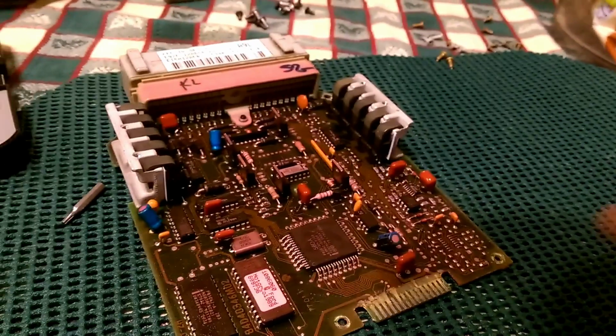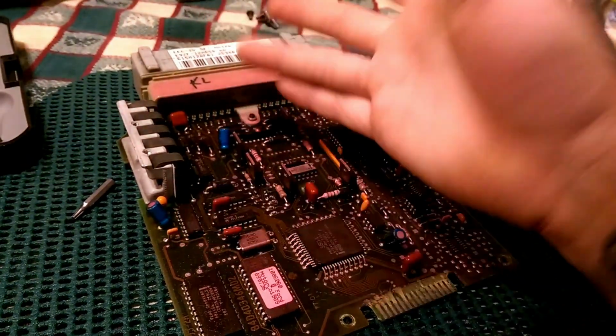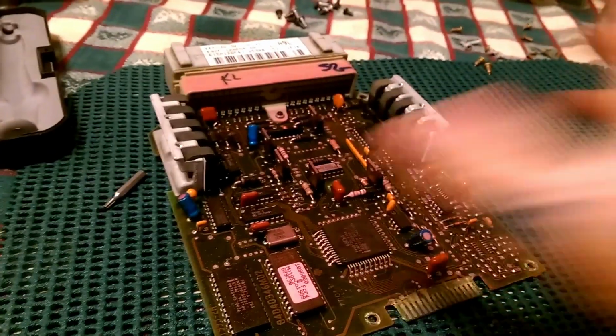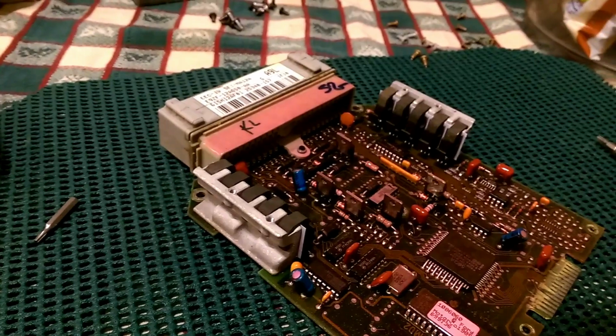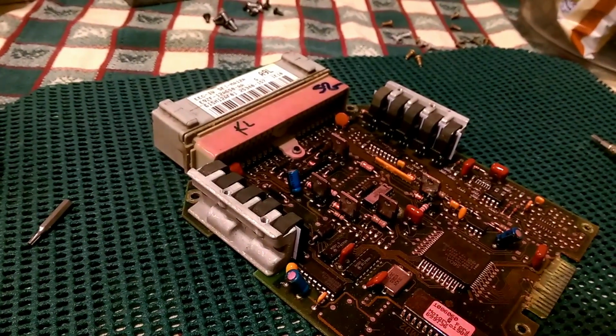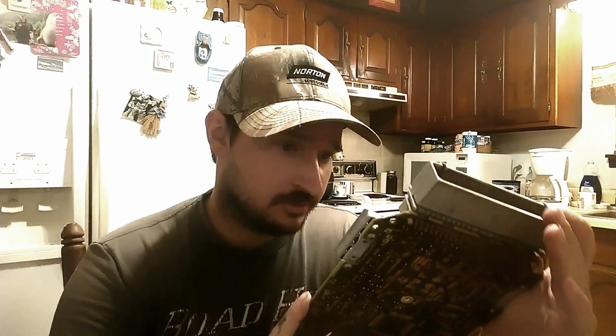Now this is due to age, moisture, age, and they leaking. It's electronics, they don't last forever. And a lot of Mustangs this happens to, even the 94s and so on. Okay guys, that pretty well shows you how to inspect your board. You want to check and make sure ain't no breakages, any bump spots. Looks like this one just needs capacitors and a good cleaning.